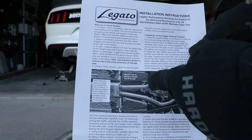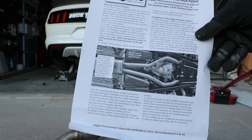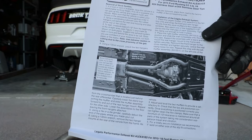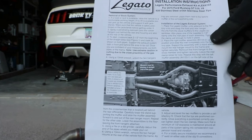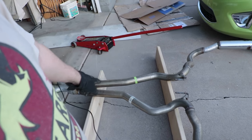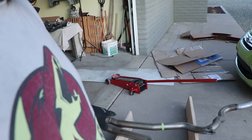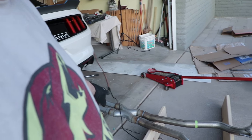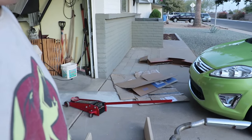Per the Legato instructions, it says where to cut the pipes — measure back two and a half inches. I'm going to tape off the line there and then lay the new mufflers in place, just kind of hold them there so they don't get scratched up, and make sure when I cut that line it's lining up. Glasses on, hearing protection on — I'm ready to cut. I've got it marked off. Ford pre-measured this size for me, their label was right in the right spot so I didn't even have to tape off on this side. I'm going to go ahead and get cutting, get these pipes fit up to the X-pipe, then start throwing it in piece by piece and get it done — the sun is slowly fading so we need to get moving.